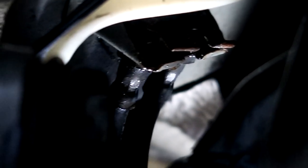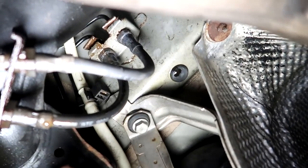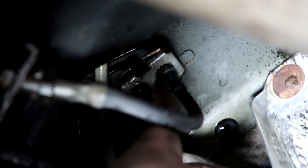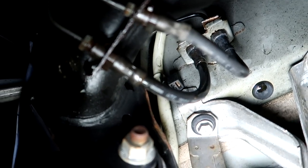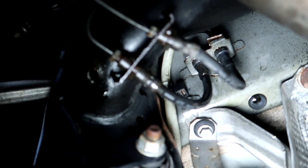I'm starting with these two rear lines because this is going to be the hardest thing. The nuts on top are rusted to the tube, so if I try to loosen those it's going to twist the tube and break them - I know this because it happened when I did the subframe bushings on the lower lines and had to replace them. What I did was bend these little holder clips up so I can pull the lines down out of this spline thing, then twist the line from underneath off.